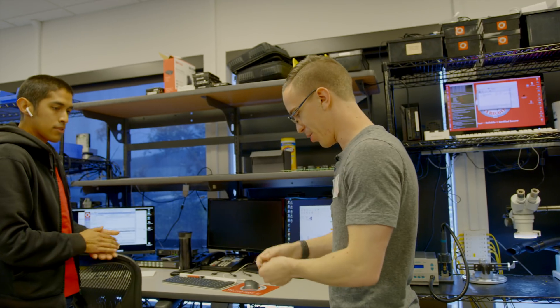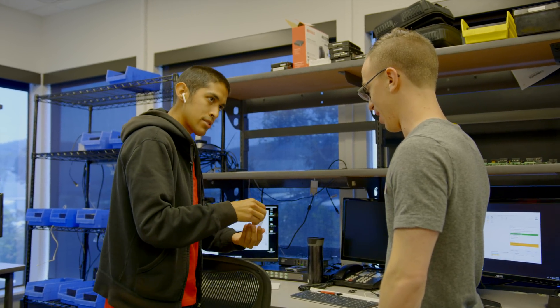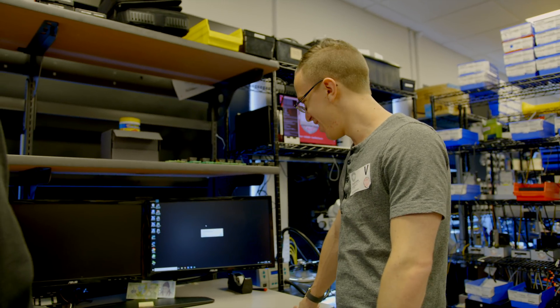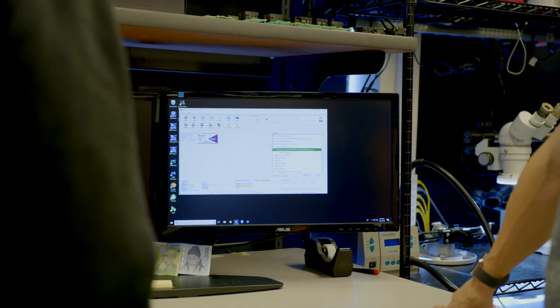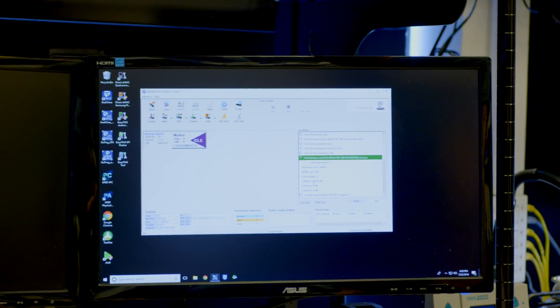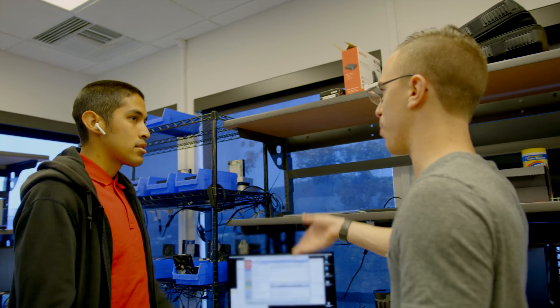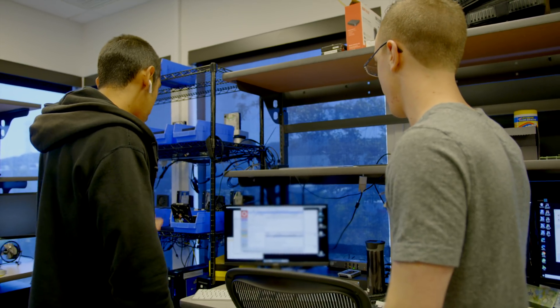40% will not get your phone up and running, but I brought the hopefully fixed re-balled NAND flash chip from the Galaxy S6. Right off the bat we've got some good signs — this partition here is our user data partition, coming in at about 30 gigabytes of data. Once everything's dumped, the danger zone is over. Even if the chip lights on fire now, all the data is safe. This has been a successful recovery of a phone that I did not break — even though I came really close. Huge shout out to DriveSavers for sponsoring this video. If you ever have data problems, you know who to contact — just don't ask for Austin.